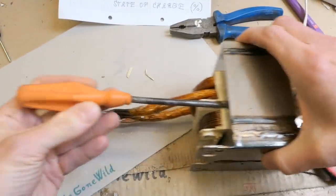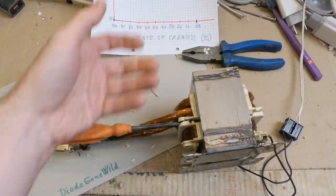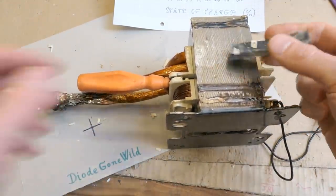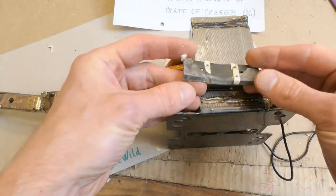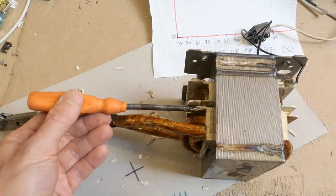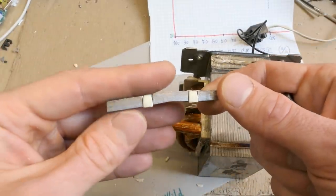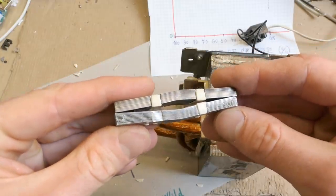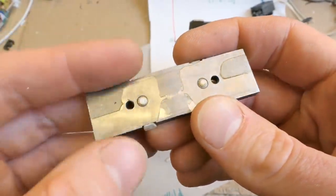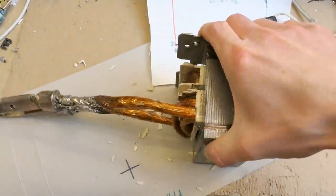Let's try to hammer it out. It's coming out, but it's not easy because there is some resin. And it's out — that's the magnetic shunt. It's basically a stack of iron sheets, and I should have used something less sharp to hammer it out. The other one comes out — this one seems easier, and it's out. It seems to be bent the same way, so it's probably from the manufacture. It was held in place by a plastic pin which I had to break. But most microwave oven transformers have just paper isolation, not plastic like this one. And the magnetic shunts are out.